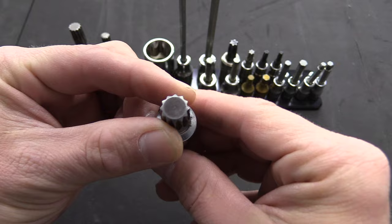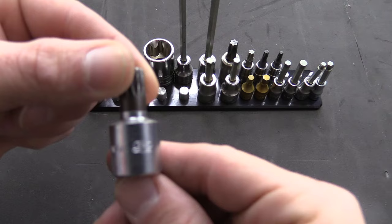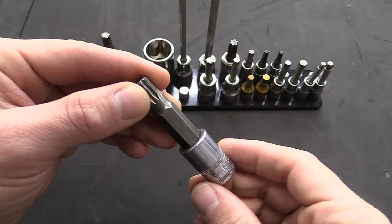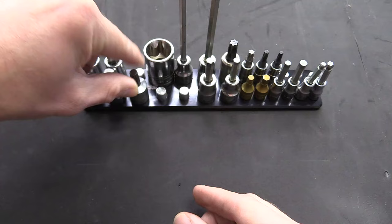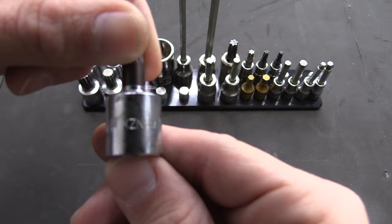In no particular order, we're going to start with having triple squares. VW and Audis love their triple square bolts, so you're going to need a handful of different styles. Here I have some very shallow triple squares on three-eighths drive, and some that are a little bit longer on three-eighths drive as well. Six, eight, ten, and twelve are some of the more common sizes, but you may find yourself needing 14s and even up to 18s. There's a set by VIM that I think is a perfect set — I'll put links in the description. I bought the Snap-on ones early in my career and they served me incredibly well.